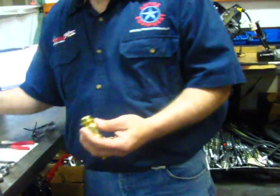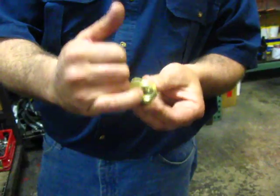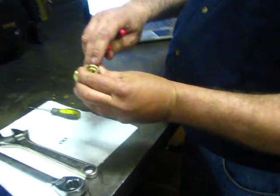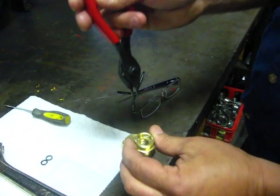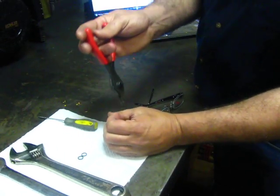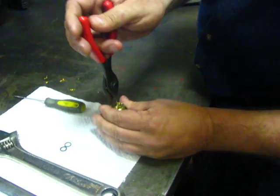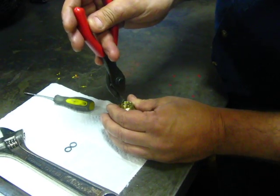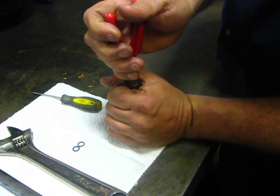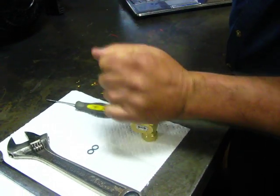The problem is in here where the silver piston is. In order to remove the silver piston, you're going to need the C-clip pliers. This C-clip has the tendency to fly away from you, so you have to be very careful. What I do is have the valve on the table and cover the entire top. I'll go ahead and grab the two areas I need to squeeze together to get it out. Before you pull it out, make sure you cover the top, because there's a strong possibility the C-clip is going to fly out of your hand and you will not be able to find it.